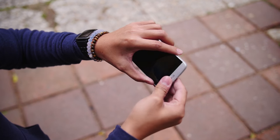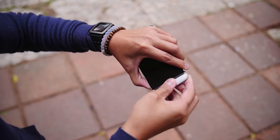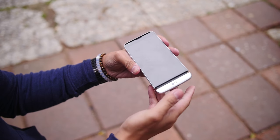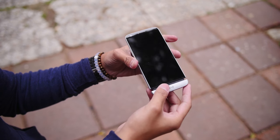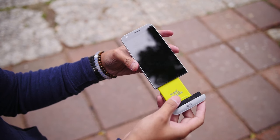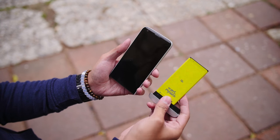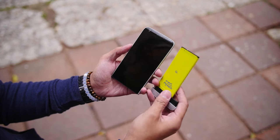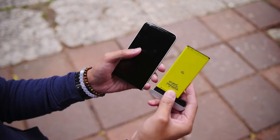As you're pressing this little area, you feel that there's a slight movement in the bottom panel that kind of comes out a little bit. And after that, by holding down on that area, you're actually able to just remove the entire area. It is very much recommended that you turn off the device first, and be able to just pop out the battery like this. This is the entire battery right here — the 2800 milliamp hour battery — and it comes with this nice little inscription on the bottom that says, 'life's good when you play more.'